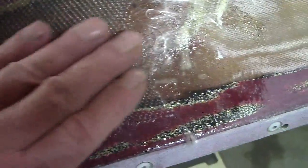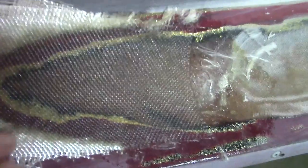Also when I was sanding, we didn't quite take our fiberglass far enough — there were a couple more little cracks right there. So I had to grind that down, and you can kind of see where I grinded it down. I made it bowl-shaped and got five layers of 10-ounce cloth in there. Then I'll get my orbital out with 60 grit. This is still a little tacky so I have to wait until tomorrow to sand it.